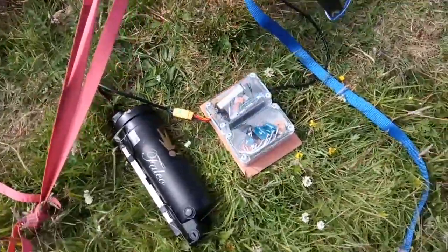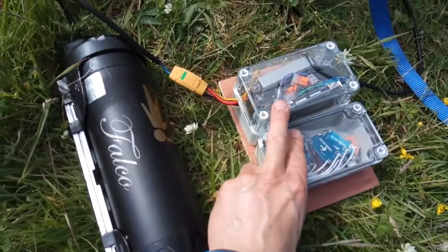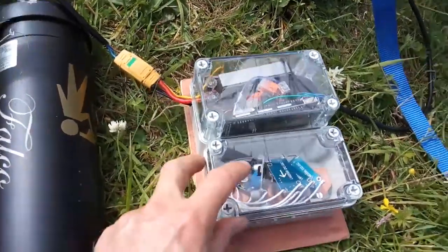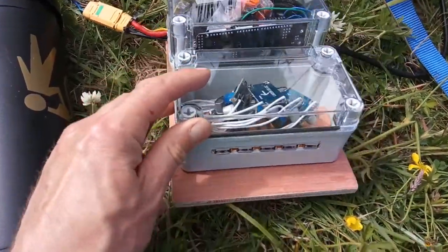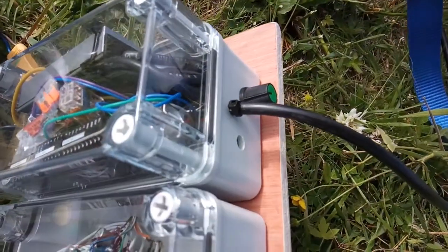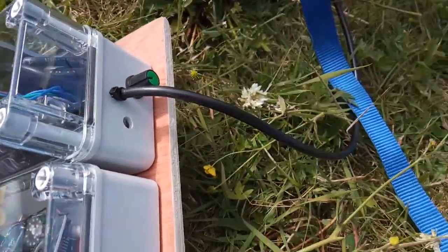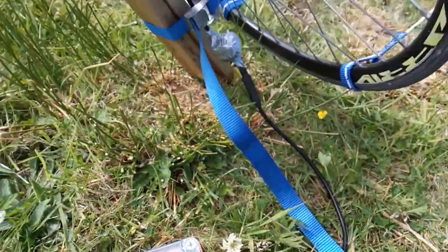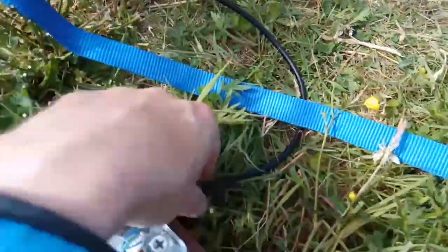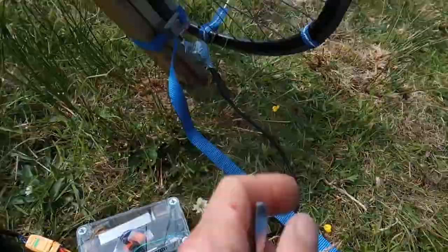Here's your charge setup. You've got your battery with one plug in there — this is all proofed off. You've got your controllers in there, and the power breaks out into these USB charging ports for all your gadgets. On the other side of that you've got the control knob to change the range you're allowed to work in. And that comes to a standard bicycle plug out of this box — very simple. You're just going to plug in the battery and plug in the motor.